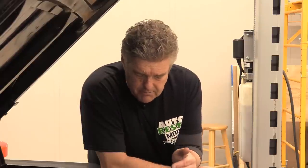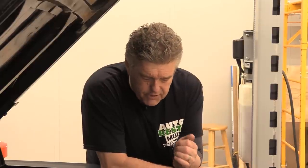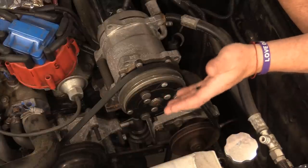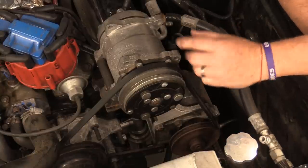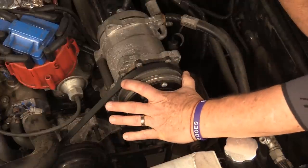What can happen in those situations is: A, you're over-driving your components. You're over-driving your power steering pump when the pulley is too small — meaning it's just spinning too fast, your rotation is too much. But because we have a misalignment situation that's actually really severe on this power steering pump, that's going to change the wear pattern on the pump itself. The other problem is the power steering pulley doesn't have enough belt on it — there's not enough belt on either it or the AC pump for it to do its job correctly.